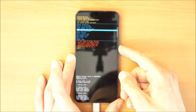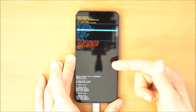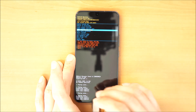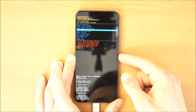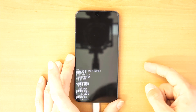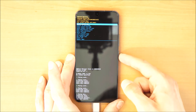Then I'm going to Wipe Data and Factory Reset. You have to know this will delete all your data, your entire phone — it will be like new, like factory, without any photos, without any data. Click the power button to confirm, and again confirm. Now it's formatting. Click on Reboot System Now and your phone will be wiped.